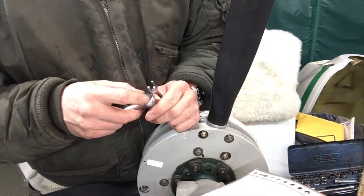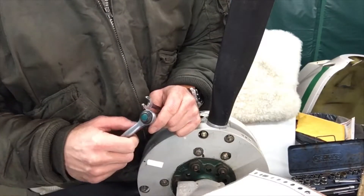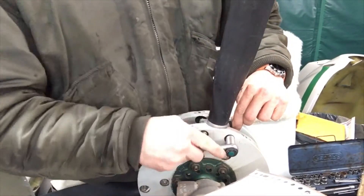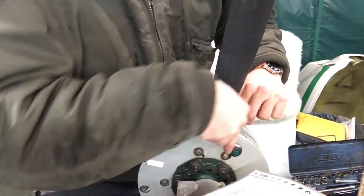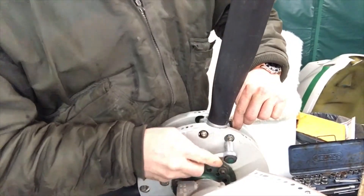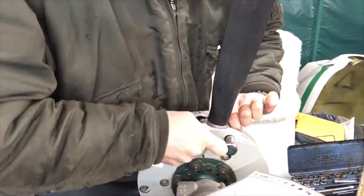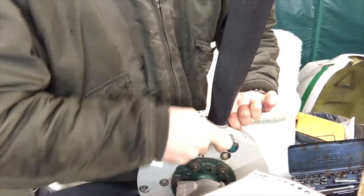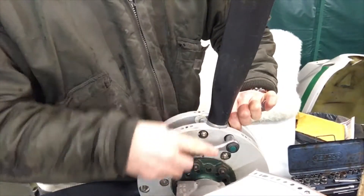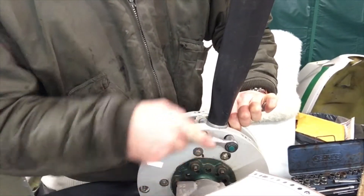When I've replaced all four per blade, I'm going to torque them with my torque wrench, doing it cross-ways. I've had this airplane now for two years, and I try to replace components whenever I'm working on it. I also completed a line maintenance course for the Rotax 914 engine, so I know a lot more about the engine now.